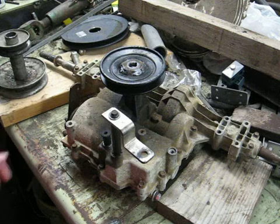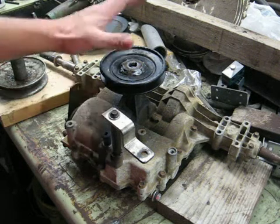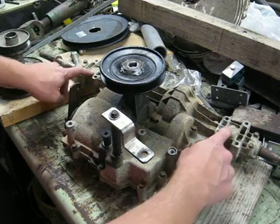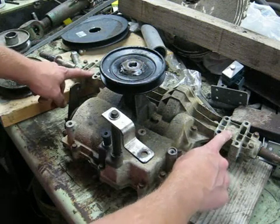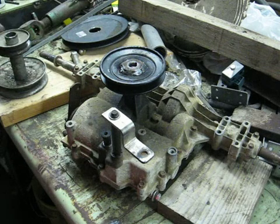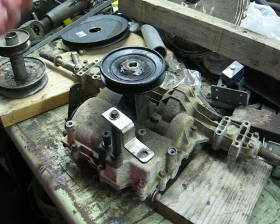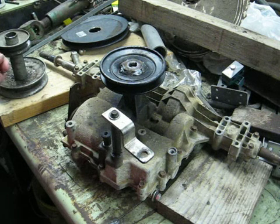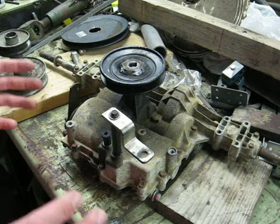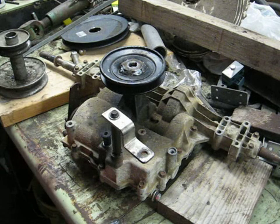There are a lot of good videos out from Doc Sprocket and Fearless Front on how they're rebuilding these things, locking the rear ends and putting bearings in. There's a recess right here on them where you can put a bearing in — Doc has that on one of his videos and even gives you the part number. I picked up a pair of them. The MST is the rear end of choice for now, unless I have to upgrade to something heavier like an 820.